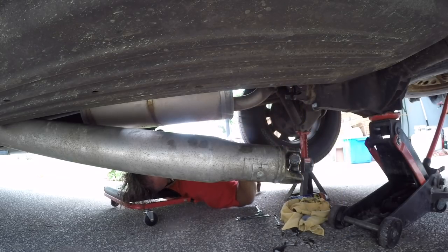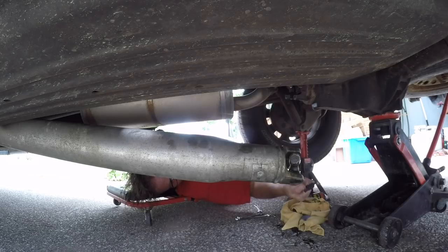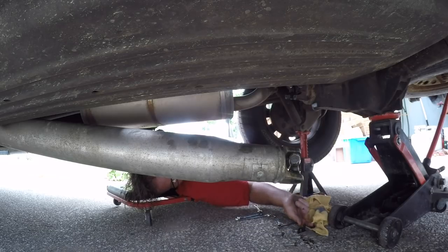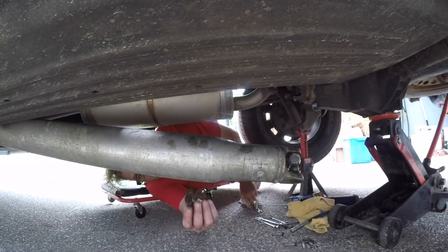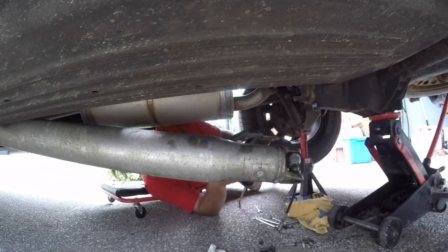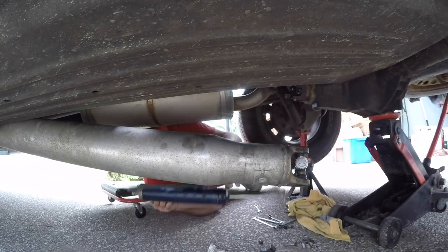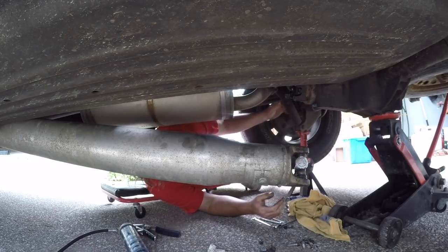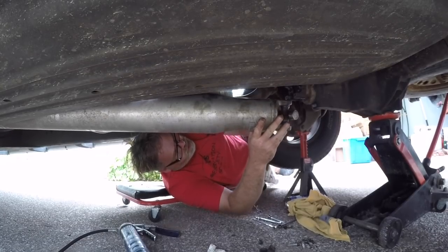So let's grease this thing up and slap it back on. Tighten her down again. Check these. There's a little bit of weird wear on them. They're a little stiff. Let's get them cleaned up a little bit. These things here are actually pretty cocked over, boys. So I got them cleaned up quite a bit. Now what I'm gonna do is hit her with some grease in here. Not a lot, because it's just gonna fly everywhere and get all over the truck anyway, so we're not gonna go crazy. And then we'll slot the drive shaft back in.